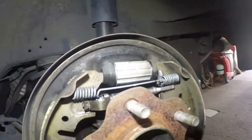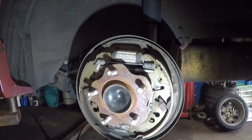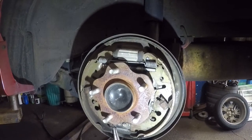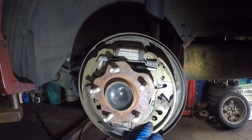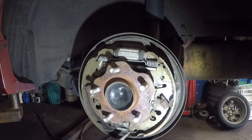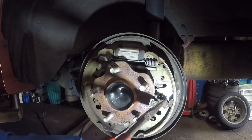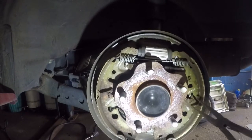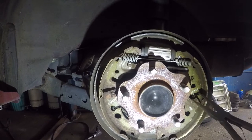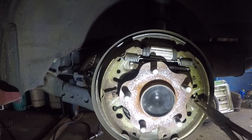This big spring is going to be hard to take off — that's the big problem there. But it's okay, we'll get it off somehow. What I like to do is use this little tool and pop this little guy, bringing it forward just past this lip right there. Same thing on this one. After that, your spring has pretty much no tension and the spring comes right out. With these retainers, it's the same procedure. They do sell tools for these, but I don't think you're going to need it.